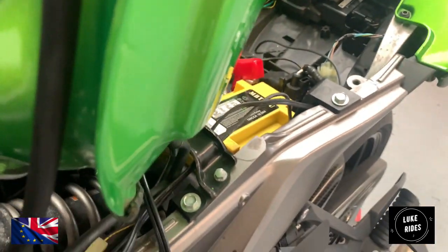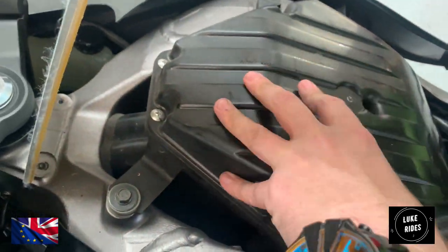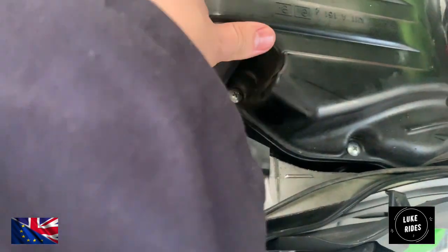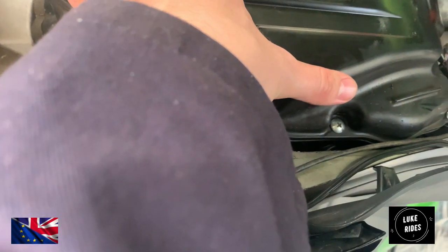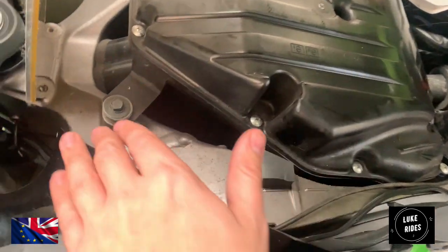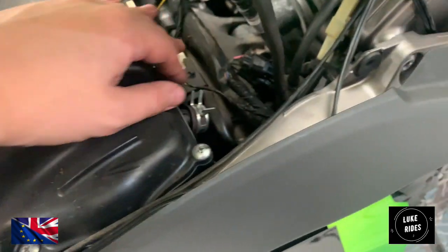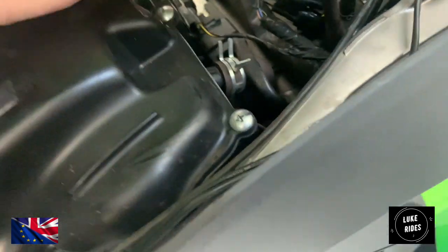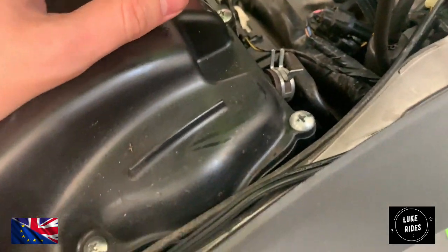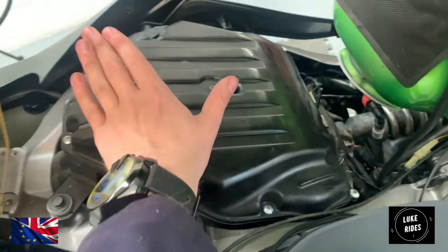And then you've got some other parts, and that's the actual airbox of the Z1000SX. The cylinders and the spark plugs are further down. I need to get this airbox out of the way in order to make progress to those spark plugs. We have what looks like a bolt that holds the airbox in place. We've also got another breather hole down here. There's a metal plate in that area which lifts up, so that's quite straightforward. But we've also got these Phillips screws here, so making progress.